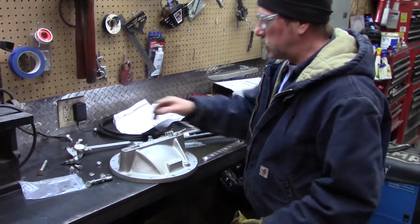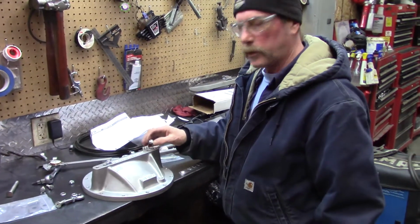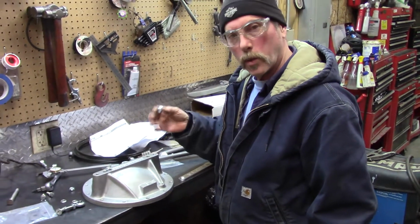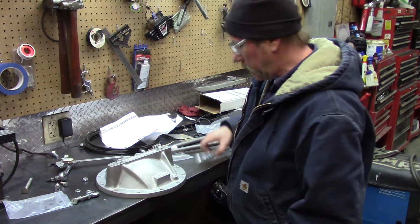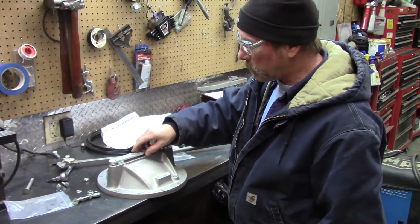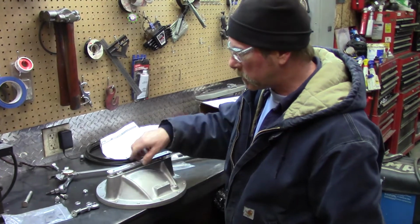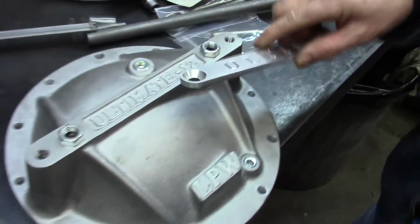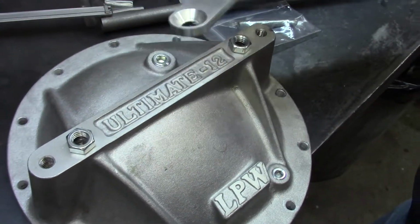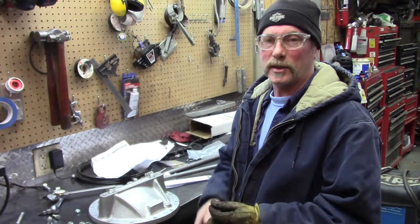I just measured these with the vernier calipers, and they're like 320. We're going to take this down to 1/4, and then this is 1/4. So that'll be like a 1/2 inch beyond our furthest point, but we're going to mill this whole thing down to this curve, because we don't need all this, and everything counts. I mean, we're really close to that gas tank.